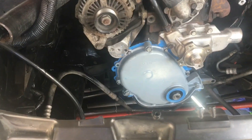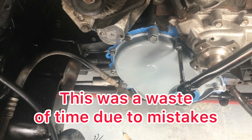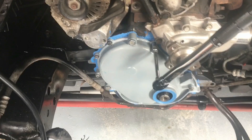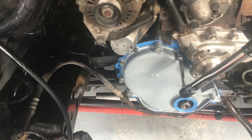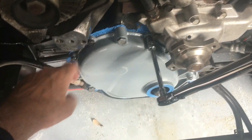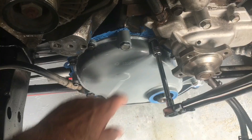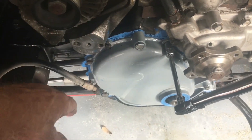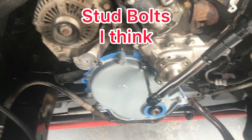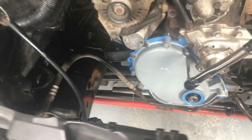My Jeep — got through torquing the timing chain cover. I believe these are the block bolts — I'm not sure exactly what you call them — but they call for 60 inch-pounds. Got those done at 60 inch-pounds. Now I'm going to torque the bigger bolts; they're slightly bigger and longer. Some sources refer to them as stud bolts, but I think they go to 16 foot-pounds. I'll check that and get back to you with the detail.